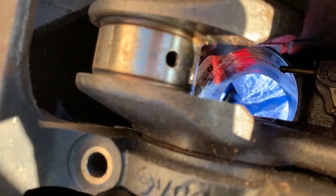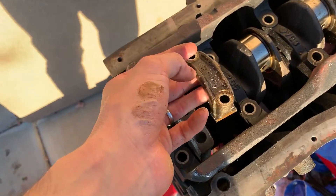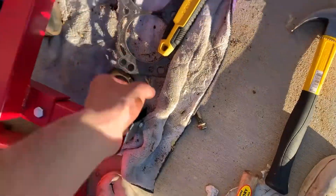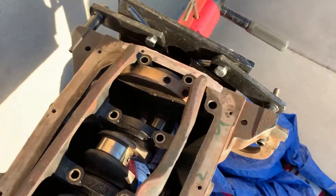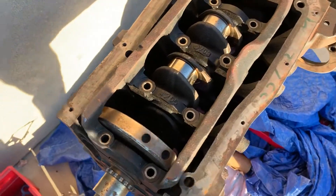This piece was stuck on the piston that holds it together on the crankshaft. What I did was rotate it to the side, hit the piston out a little bit, kept this part separate, and took it off — worked out nicely. I'm going to try to figure out how to take the crankshaft off. I messaged one of my buddies, and he recommended smacking this part super hard with a mallet because it's going to be on there super tight — after you remove all the main bolts. So apparently I've got to smack the crap out of this part and it should come off.